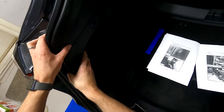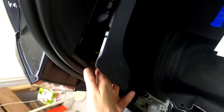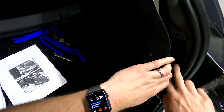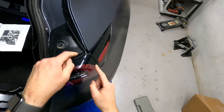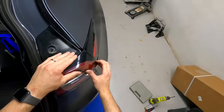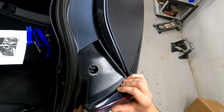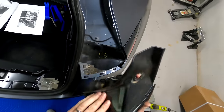Now we pull back and pry the door panel back. There's a power supply back here if you need power. Pry this back enough to get to those bolts - I believe those were an 8mm on the Model 3. You get both of them off the same way. Once you have the two bolts off both sides - I already took one off - it's just a matter of wiggling and pulling. The two pins are on this side, one here and here, which correspond on the other side. Kind of grab on this side and it's popped loose. You need to disconnect the wire too - wiggle the wire loose and there you go.